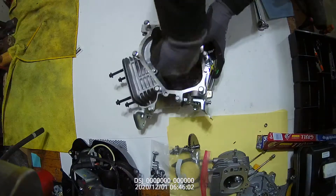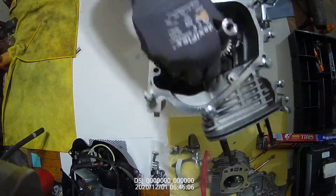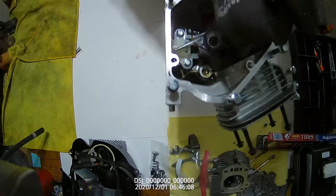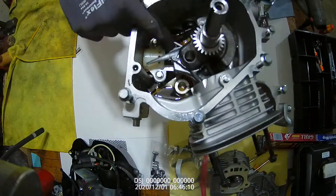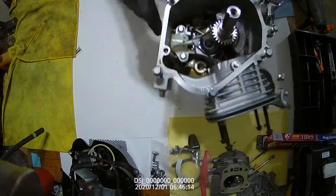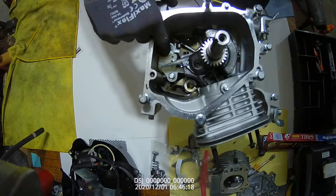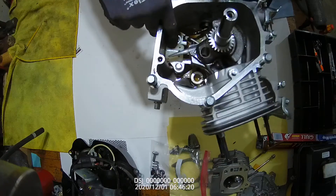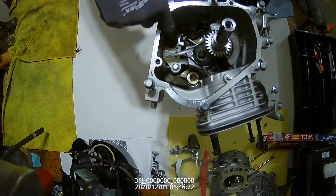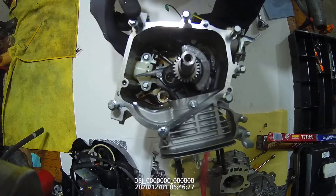Now you can see that we can rotate this crankshaft. If we look on the crankshaft, we've got a dipper. This dipper will go down into the oil bath, because normally the engine sits this way, and splash oil around the components. This plastic mechanism right here is the low oil level signal. And if we look in the far back, we'll actually see our governor.